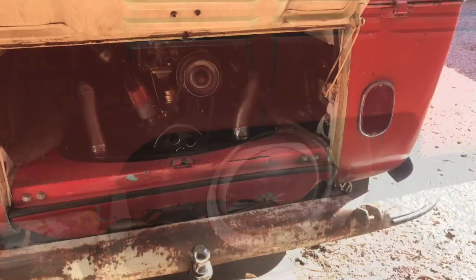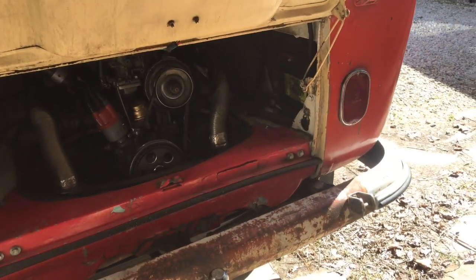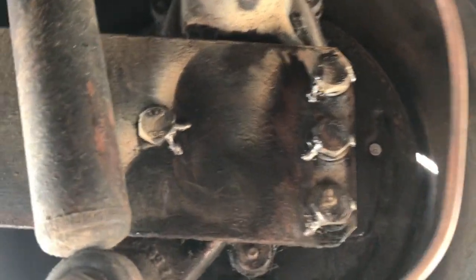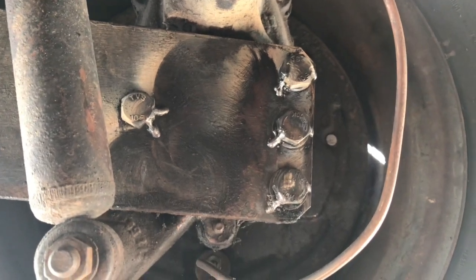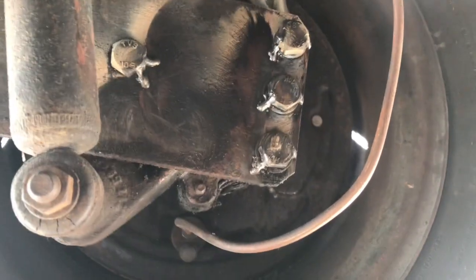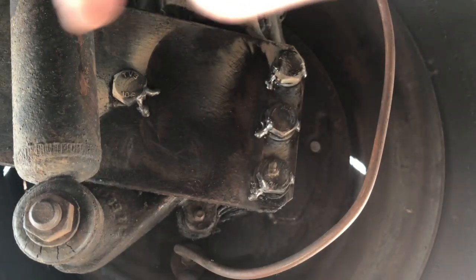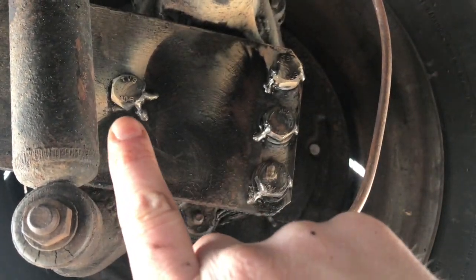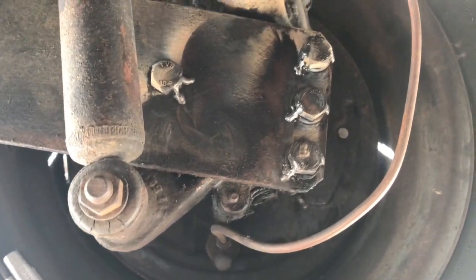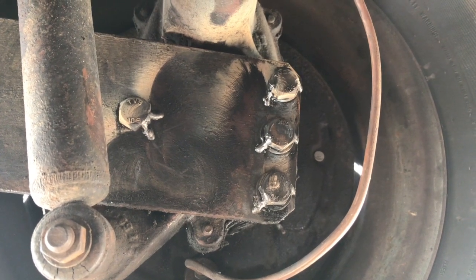Let's get her welded up. And just a little reminder, before you weld on anything that has a battery, unhook the battery. Well, there's my redneck solution to those boogers backing off again. I tried to make it where if the bolt actually started to turn, it was going to hit a spot on it, so that when it starts to back off and come unthreaded, the point of the bolt hopefully is going to hit a clump of weld. That stuff's really challenging to weld though, because there's so much gunk and funk on it.